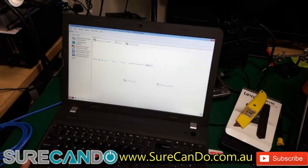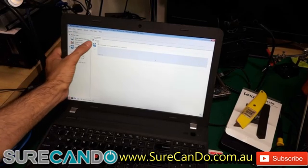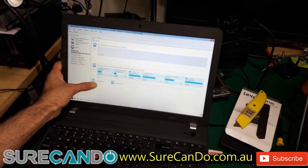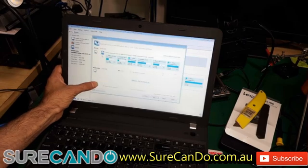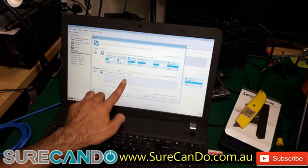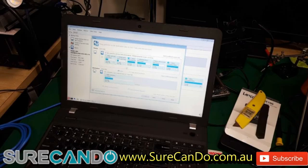Go into the backup menu, refresh to pick up the external hard drive, click on this drive, clone this disk, select the disk to clone to — found our new hard drive. Going to drag and drop — yep.